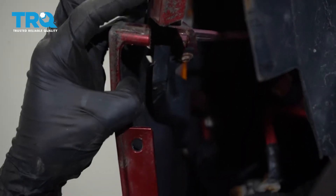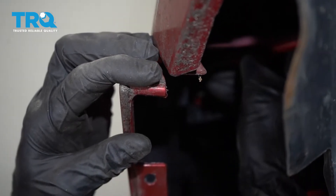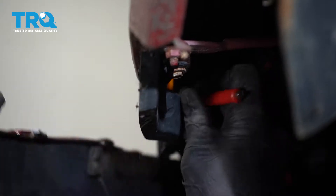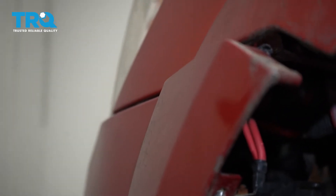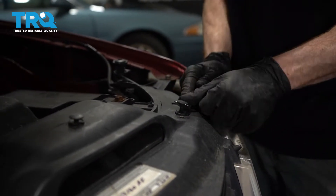There's that screw — go ahead and pop this free. Let's use a small pocket screwdriver and carefully get underneath each of these ears on the bumper cover. We just want to separate the lock area so we can pop this free. Now this side is complete; we can continue over on the other side. Once that's popped free, we'll get up top and remove those push clips. Back up top, we can start removing all of our push clips here.